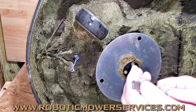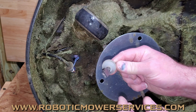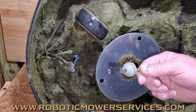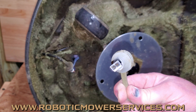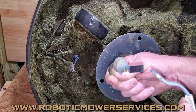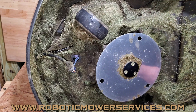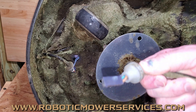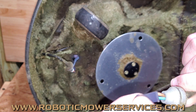Here's one where we have the wires stuck in there yet — the end of the plug on the charging plate side still has the wire ends from the harness in it, but the plug was not melted at all. When we went to unplug it, it just ripped everything right out of there. If you look inside, you can see the prongs from the inner harness wire are stuck inside the plug for the charging plates. Most of them have that little grayish discoloration blemish on the side of the plug, but it's not melted or bubbled out like the other ones.